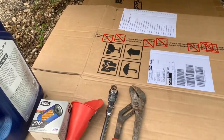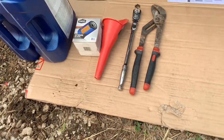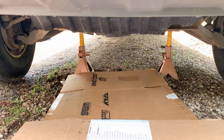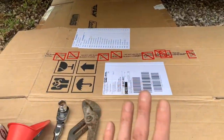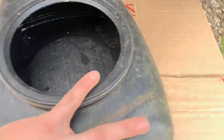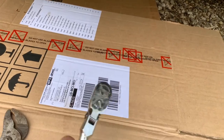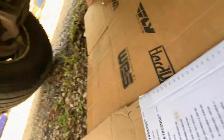I'm also going to show you how to reset the oil light as well. The first thing you're going to want to do is jack up your truck — you can see I've got it on jack stands. It's always a good idea to have some cardboard, and you obviously need something to drain the oil into. Slide that underneath there, then get your 15-millimeter and take out the drain plug.